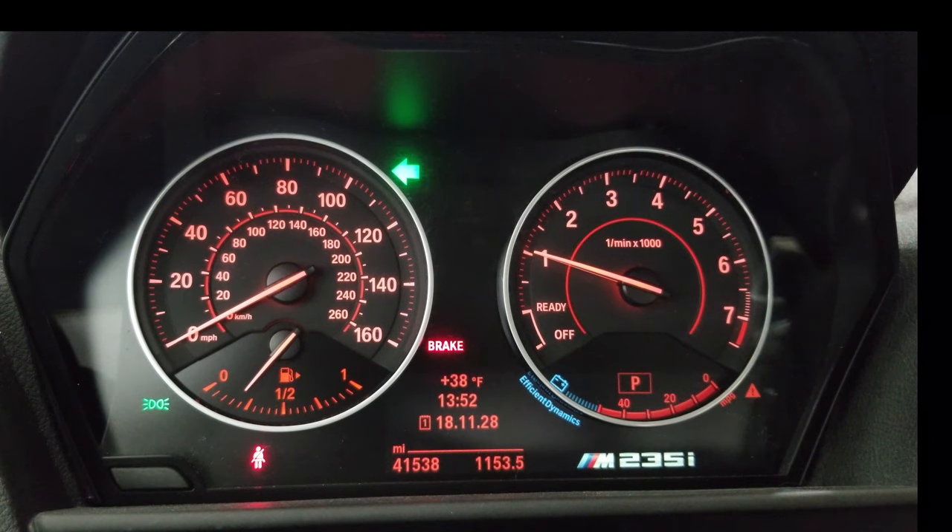Pushing the BC button again brings it back to zero — the map — and I'm on map one. That really covers everything in the JB4. Check out the N54 Tech website or email Burger Motorsports if you have questions — there's a ton of info. It's not difficult, just push the BC button and get used to how it works. Push BC to go to the tach, push again, and it's back to stock function of the gauges.